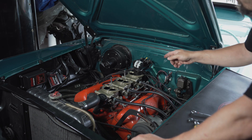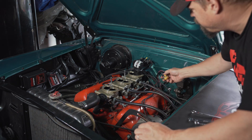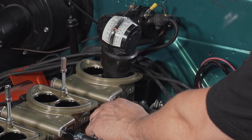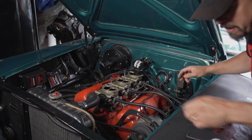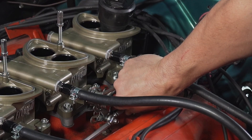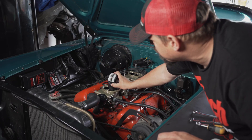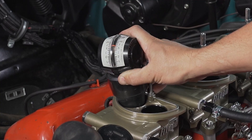To reduce airflow on the back, Jeremy will adjust the throttle screw with a screwdriver. After adjusting it all the way, the airflow still didn't go down, so Jeremy will adjust the linkage. This did bring it down, but up front there is uneven airflow, with one side running close to 6 and the other at 4.